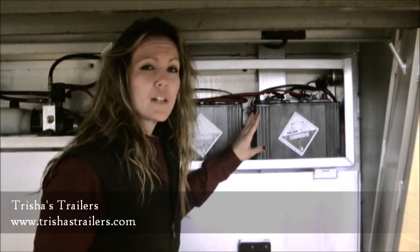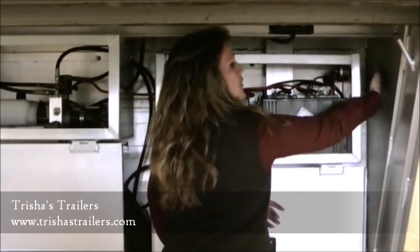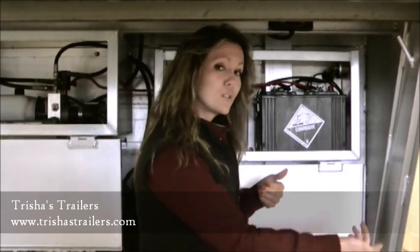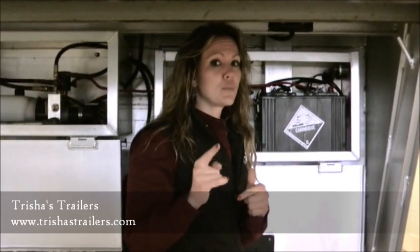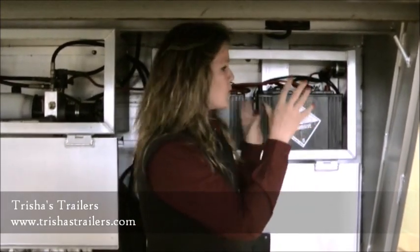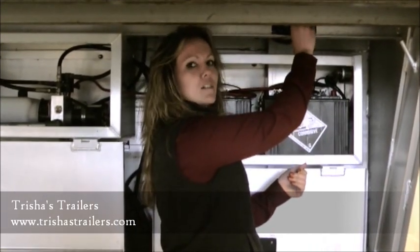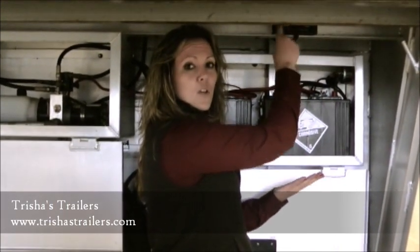Here are your batteries in their own individual box. You'll notice to the right of the batteries you actually have a battery kill switch — an on/off on this side. You want to have that battery switch set to on if you're looking to charge these batteries while you're plugged into shoreline power. If it is off, your batteries will not charge. The exception is if you're plugged into your truck and the truck is running — it will automatically charge those batteries whether that switch is on or off. Remember, you need these batteries to be fully charged and functioning well to run your jack, which is right above there. You've got a key on/off and can simply raise and lower the trailer with a push of a button.